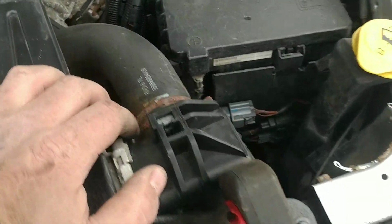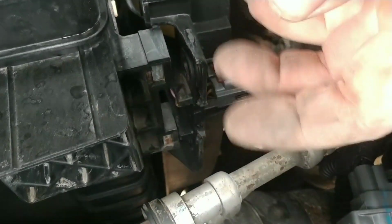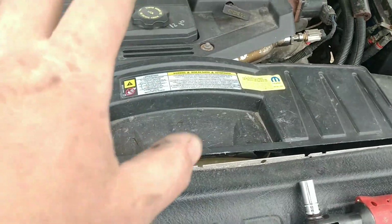Before I start draining the antifreeze, I go underneath it, and there's a shroud that comes under with some push pins on the bottom of the fan shroud. It's like a hush panel. You got to pull them out and then come up here and take the electric fan clutch loose right here on the side of the shroud. Then you can take the shroud and fan clutch out as one unit. You can't make it out, but I'll show you once we get that out there.